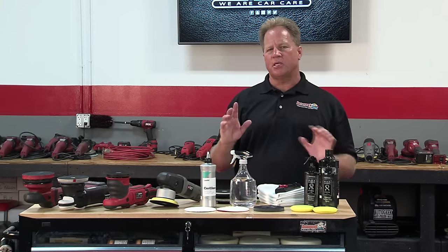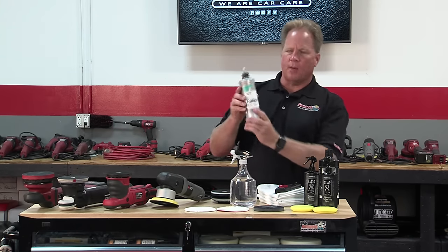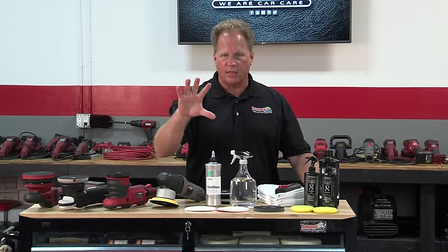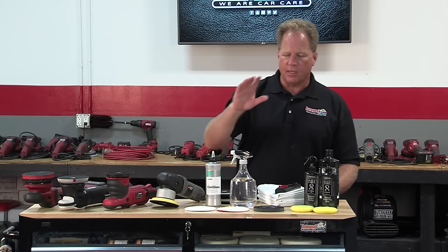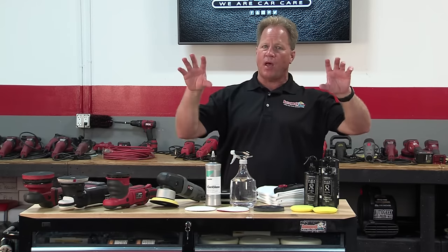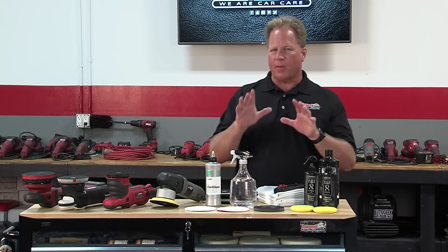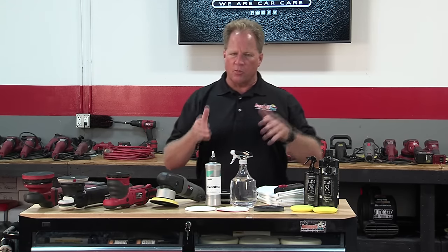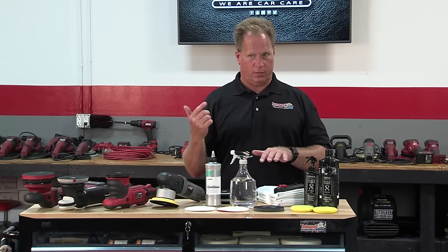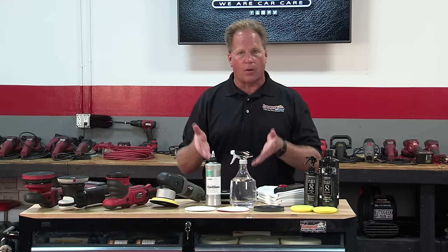But here's a couple tips. These are real important. First, if a company that sells a polish also sells a pad, buy the system. And I'm going to tell you this because one of the ways I found out is I tried one company's polish and another company's pad, and when I went to polish on the glass, it actually put scratches in. Now think about it. If the things I have to remove scratches are putting scratches in, and that's all I got, I'm stuck because I'm not going to be able to fix the scratches I just put in because the things I bought aren't working.